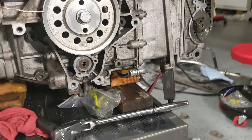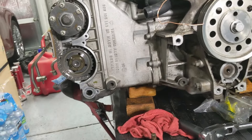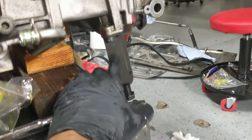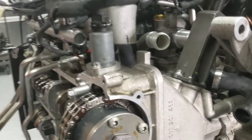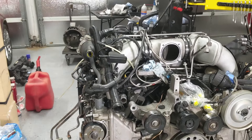On bank one I was getting some chain slippage — I've got a video documenting that. The fix: I got ahold of James over at Shark Works and he gave me some information on these chain tensioners. There's a painted line on there that tells you when it's got enough pressure against the tensioner. The other one's up here, you can see the painted line on that one too. Now that the engine is timed and torqued, I'll put the chain tensioners back in with the oil feed lines, and then the valve covers.